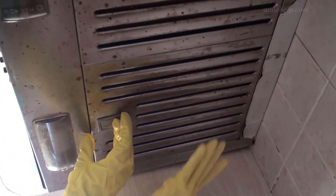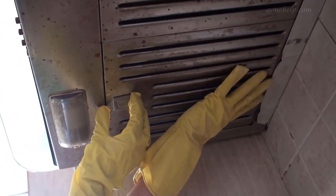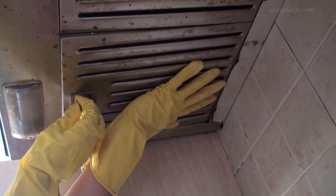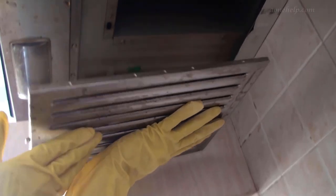These filters seem to be very dirty and oily. We should give support to the filter with our other hand to avoid filters from falling down. To remove these filters, let's pull down the latch clip. Now pull the filters downwards and shake it. Filters should come out easily.